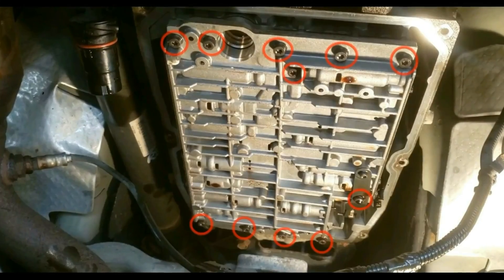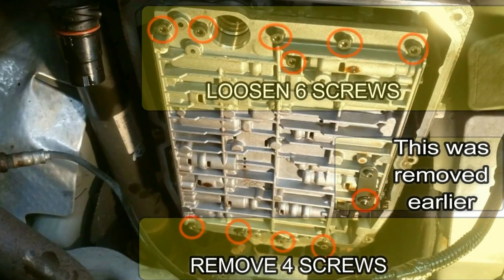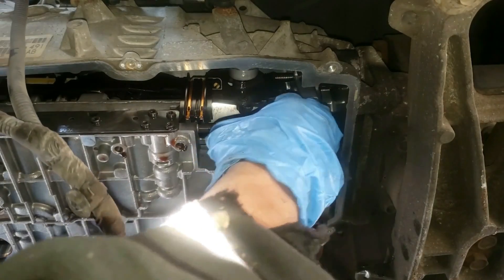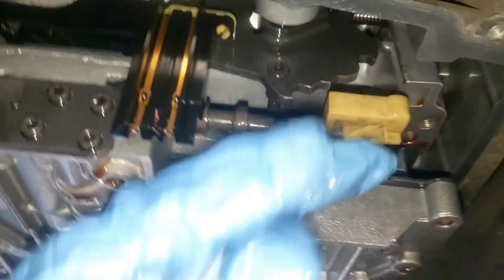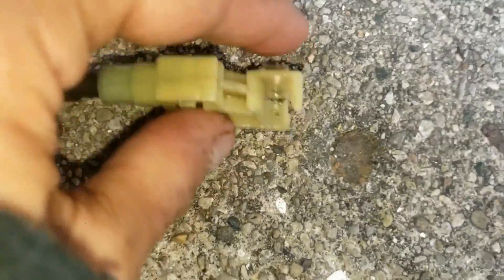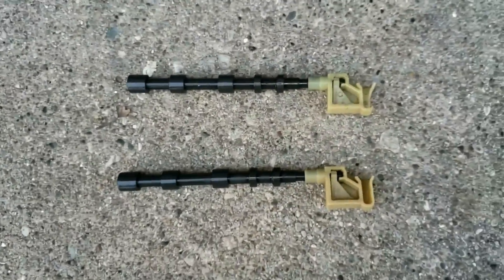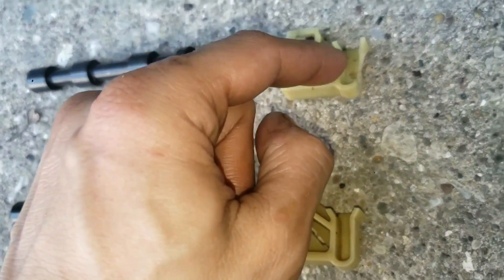I have to alter some more. I took all the T30 bolts off in the rear and loosened the ones in the front. Let's see if I can pull it out. See? This is a valve rod. It broke on the side because it wasn't lined up properly — it's plastic. You can see that the new bottom piece has a nice Y-shape or U-shape design where the gear rod fits into in the transmission. The top bad valve rod was clearly busted from misalignment when it was reinstalled.